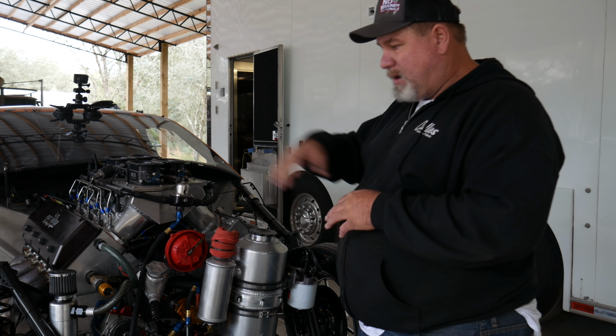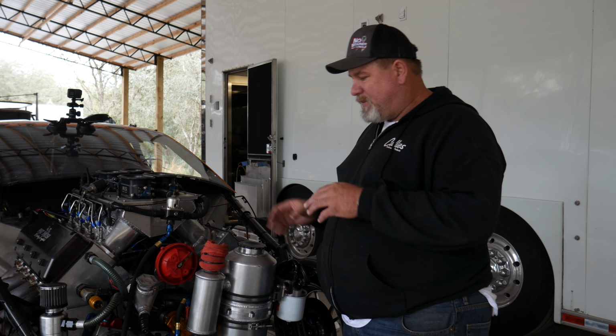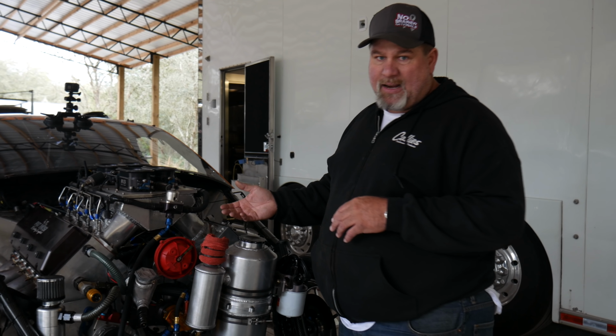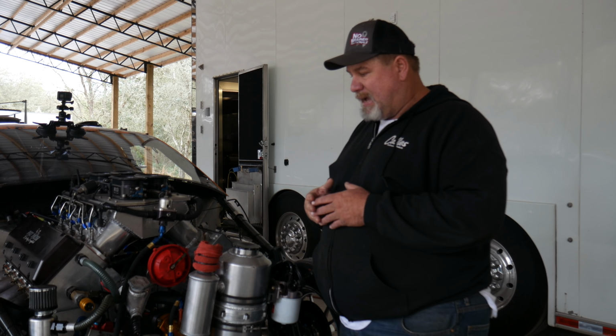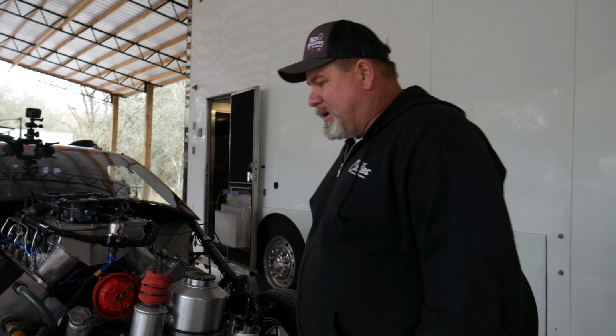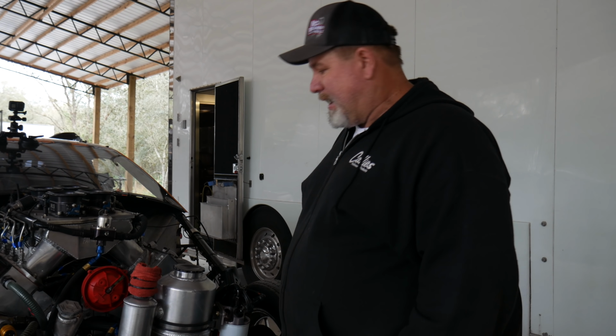That's the problem. The motor has a firing order it's got to go through. So when it's not hitting on its firing order, even with the cam in time with the crank, it's basically firing on different cylinders. When it's firing on different cylinders, it's all bad, especially in a motor this size. That's what really hurt the motor so bad. It was basically just firing on different cylinders.